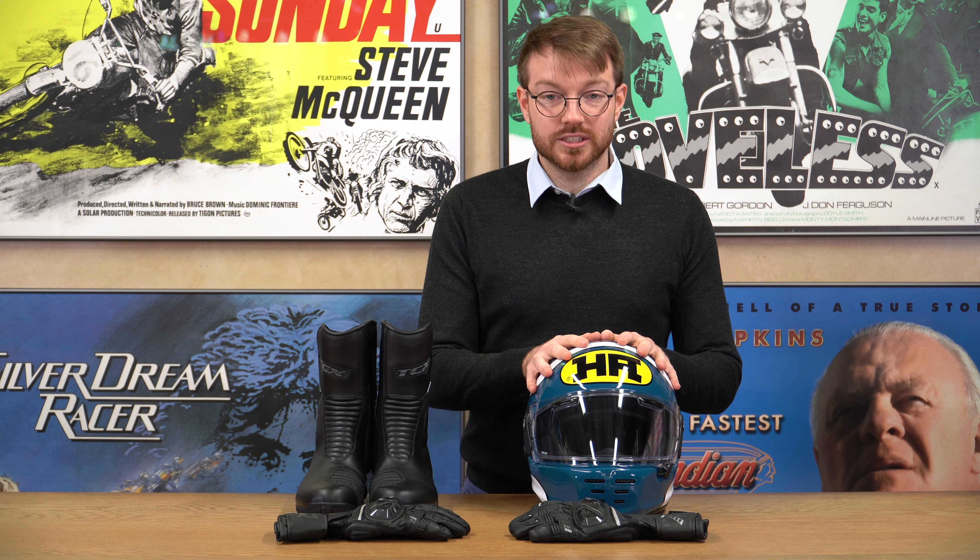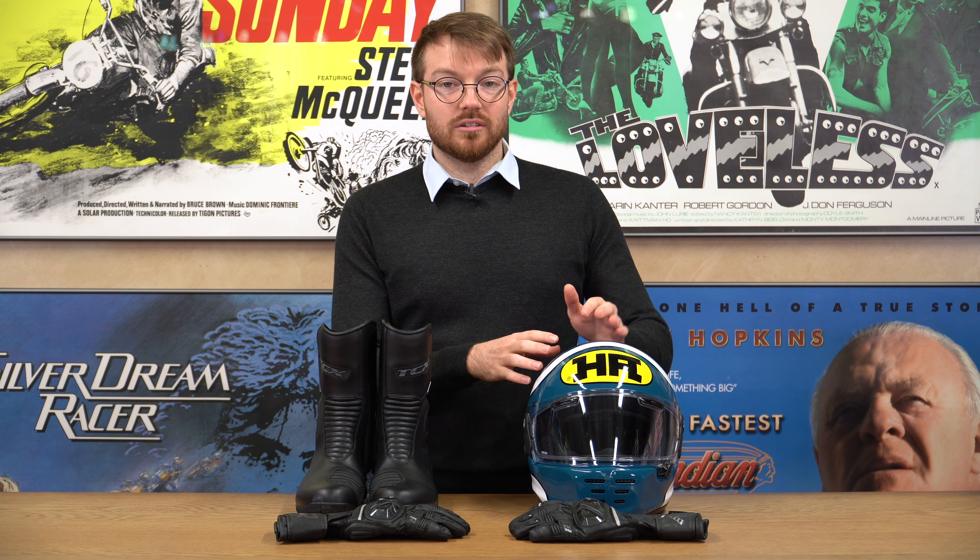Keep your gear indoors. It will help you get better longevity out of your motorcycle gear. A helmet is made up of different components, each of which will react to heat slightly differently. If your gear is kept outdoors and in summer it's heating up, then cooling at night, everything's expanding and contracting — that causes stresses on elements that are bonded together, such as the EPS glued against the shell and cheek pads. Keeping your gear indoors will keep it in much better condition over the long term and will also keep you safer. It will also be a much more comfortable experience going out and putting on a warm jacket on a cold winter's morning.